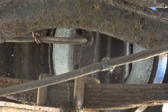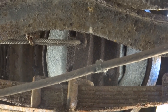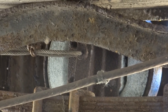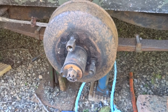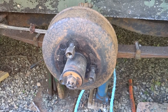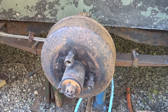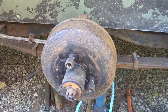The back plate of the brakes is made of cast aluminium, and the brake shoes themselves are aluminium castings on aluminium and brass pivots. I've taken one of the hubs off and the bearings, which have brass or phosphor bronze cages, are in absolutely amazing condition — beautiful unworn bearings, which is great because they might very well be hard to obtain in imperial size.